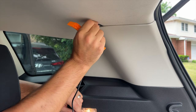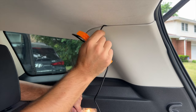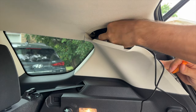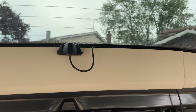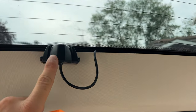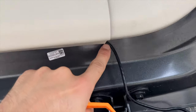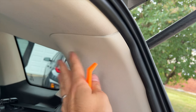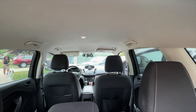This is going to be the place where I'm going to put most of my extra wire. I just need enough to reach the tailgate — there's plenty of space here with no airbags or anything like that. I'm just going through the grommet inside there. So here's how I wired the rear camera: it's attached with double-sided tape to the panel looking out of the window. The wire goes inside behind the panel, comes out on the other side, goes through a grommet, and all the extra wire is hidden behind the C pillar or D pillar in the back. All the wires then ran all the way to the front and connected to the camera. That's the whole install.